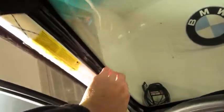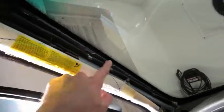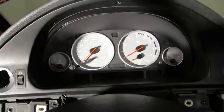The size you're looking for is T25. Pull that screw out and carefully work the trim out, noting that the door seal can move to help. Start on one side, get that side to pull out, then swing it out and pull straight toward yourself. That works the same on both sides. This reveals the A-pillar airbags, and there's also a hose here — the channel that drains water from the sunroof area to outside the car.